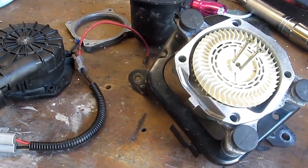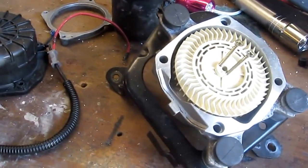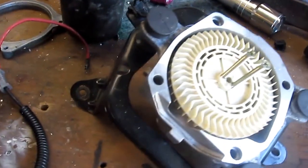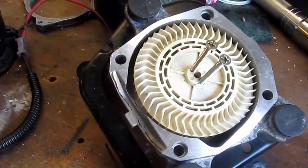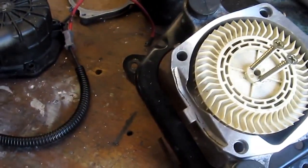It ran for about a week and all of a sudden the engine light came back on. The first thing I did was take out the motor, figuring that since that's the part that had to be repaired. I took out the motor to see what was going on, and you can smell it — it shorted. The little wire on the one tab apparently shorted over to the other windings.